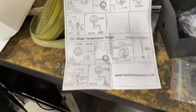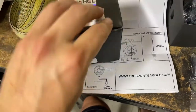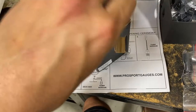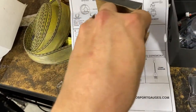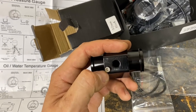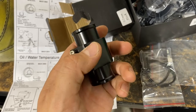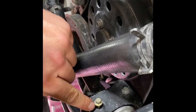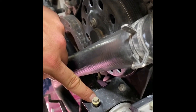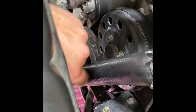When you get your Pro Sport gauges, it comes with instructions and obviously all come with the sensor. I'm going to install the sensor in this piece right here, and this attaches into your coolant line. You thread it in here, and this is your ground. You do want to run a ground in addition to the wiring to a chassis ground or somewhere on the car, because just because this is hooked to rubber you won't get a good ground. I plan to mount my sensor housing right here to keep it out of the way. I checked with my multimeter — from the threads inside this hole back to the negative side of the battery, I had the same resistance as if I went directly to the engine block. So I can just run a really short little line from here to there.